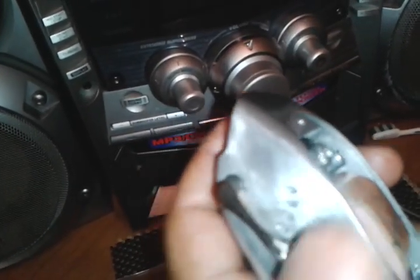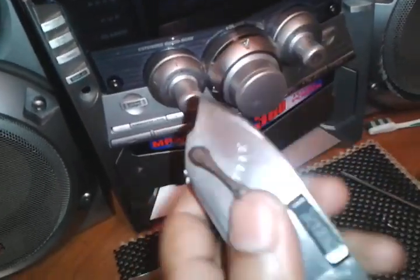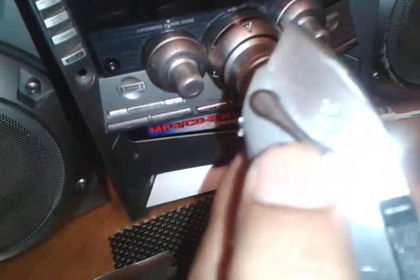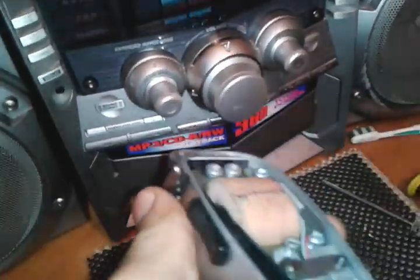But also when you do that, make sure your lever is stiff, sort of stiff like this. Don't have it too loose, because if it's loose, it will cause the blade sometimes to adjust on its own, and the comb blade will push back on its own when it's let in. It can cause the cutter blade to overlap and still cut someone. To get that to be stiff, for these 4 screws here, you tighten those up just good enough to where it's stiff, because you don't want it too tight. If it's too tight, you won't be able to adjust this. But you don't want it loose either. You just want it firm, where you have to put a little pressure on it to cause it to move. You do that with these 4 screws, and that'll give you a stiff lever to keep it from cutting anyone, causing anyone harm.